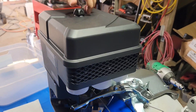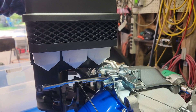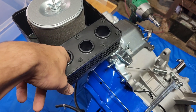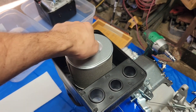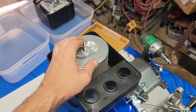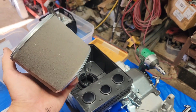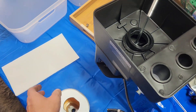We also noticed it's got a weird air intake to the side going on over here. Anybody want to put a hypothesis as to what's going on there? I wonder if those are moisture catches right there. This does look to be the same size as the regular Duramax 440 filter — which, by the way, if you're dealing with one of those 440s, the filter is a proprietary size on the bottom. It's not the same as a GX390, even though all the Amazon sellers tell you it is. Order this directly from Duramax, otherwise you have to do a whole bunch of cuttery.